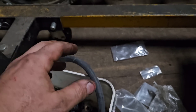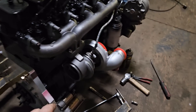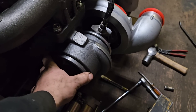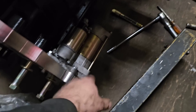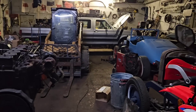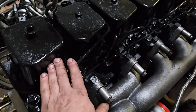If this sounds complicated, all you have to do is buy the line. But if you're trying to save money, that is one way of doing it. Now the downpipe off the turbo — this is a four inch. You have to buy that, and you're going to end up denting the firewall to clear this exhaust. I suggest header wrapping the pipe on the way down — it keeps the heat off the starter. I have torched a starter on the silver one and had to header wrap that one. Another clearance issue: you have to clearance behind the engine because the firewall would be right about here.